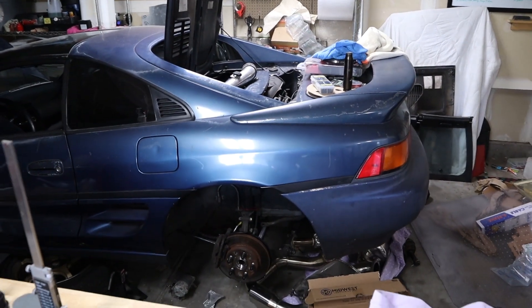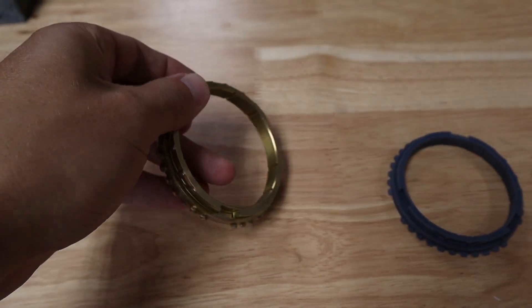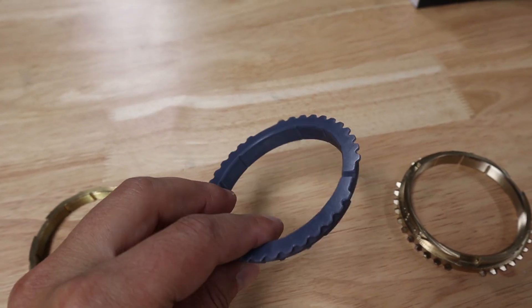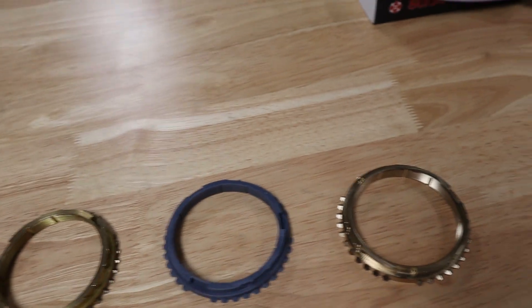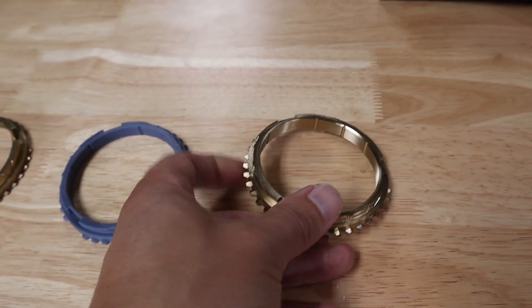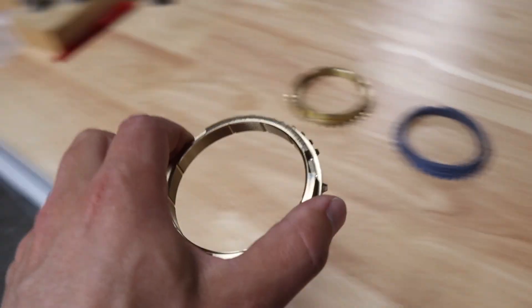I've been working on a huge project for about six months now and I want to do an update. I've been working on synchronizer rings for the e153 transmission in the SW20 MR2s. My car is on jacks, transmission removed, got my transmission in pieces. I pulled out the OEM synchronizer ring, drew it up in CAD, had a friend 3D print it to validate my CAD model, and I ended up machining ones. This is my first attempt at it on my Tormach, and I'm about to install it and do a little testing.